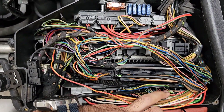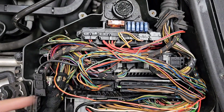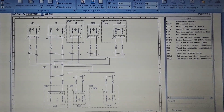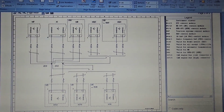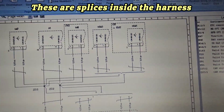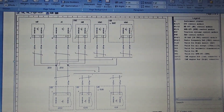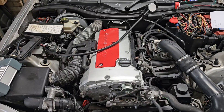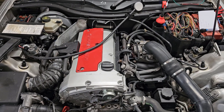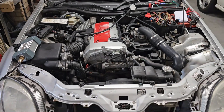Unlike many other cars, the CAN signal wires are not twisted but shielded — they are white and green. Based on the module diagram from WIS for the CAN bus wiring, the legend shows that Z37-3 and Z37-2 are the connecting points for all the CAN high and CAN low lines, so you can connect these together yourself and bypass some faulty wiring. I hope this video helps you diagnose the electrical issues on your SLK. If you have any questions, please put them in the comments so everyone else can benefit. Thank you so much for watching, liking, and subscribing — have a great day and enjoy your Mercedes!